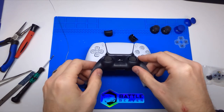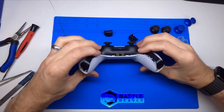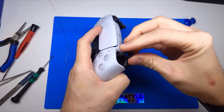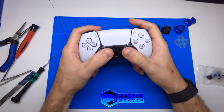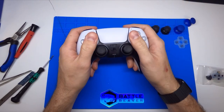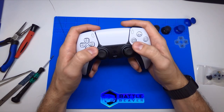With this trim piece, it goes down into those little holes. Push down in the middle and come down around the edges. Then you'll reinsert your bumpers — if you look, they can only go in one direction. And there you have it — you have upgraded thumbsticks inside your DualSense 5 controller. This will give you a little bit better control and a little bit more contact surface for your thumbs, and you can match your preference. We will be uploading different styles, heights, and types of thumbsticks to our website as this controller launches. Keep an eye on BattleBeaverCustoms.com — we have all the tools you need and a great support staff to answer any questions. Thank you for watching!